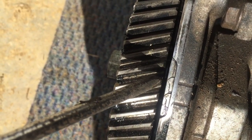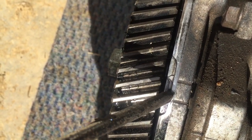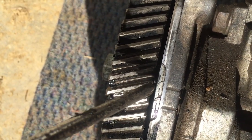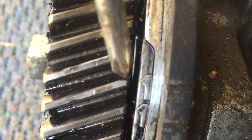If it's a non-turbo vehicle then you would spin this wheel, this notch, and you would align it with the non-turbo. So right now, because my vehicle is a turbo, I have it lined up with this mark here.